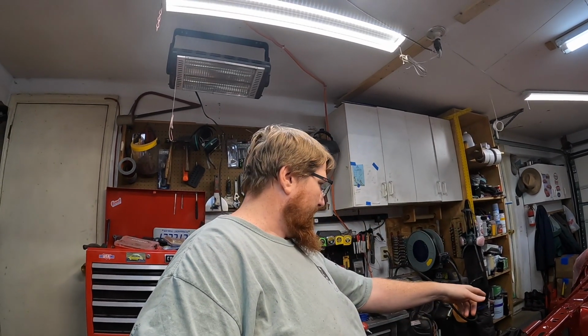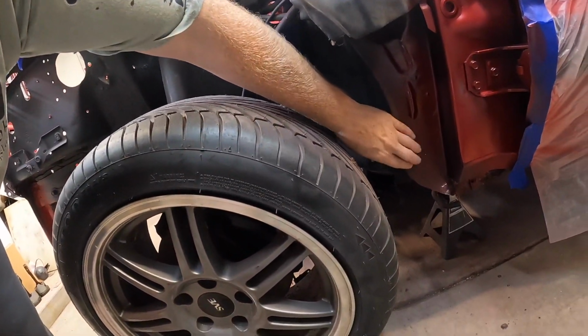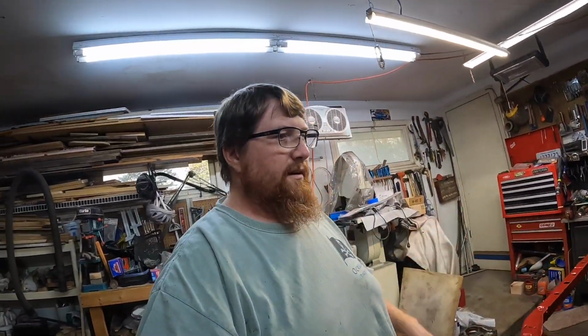Going to go ahead and get this thing sanded down, and then probably not even sand it down. I mean, it's got a nice, decent finish on that from LMR, so probably just go ahead and scuff it up. I got some sealer primer in a can over there that I'll have to paint it with, just to have a lighter background to paint the red on, you know what I mean? Because I did paint some of this strawberry on black area down there, inside the doors, and it didn't really show. If the camera's not showing it, it's really dark on there, and I didn't paint that with any light colored primer, like a gray primer, like I did the engine bay. But yeah, let me go ahead and scuff that up.